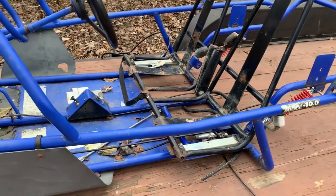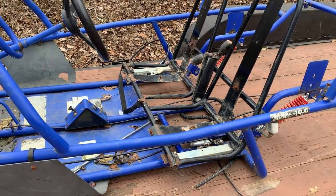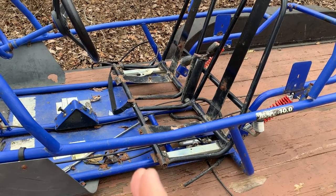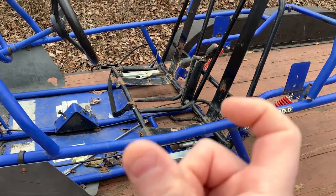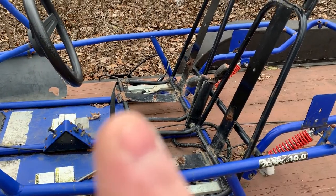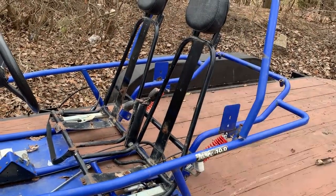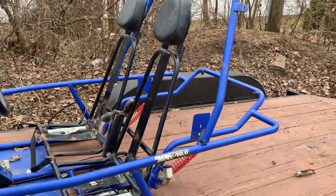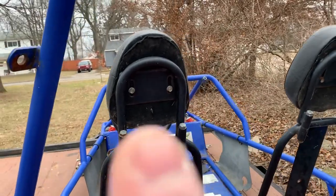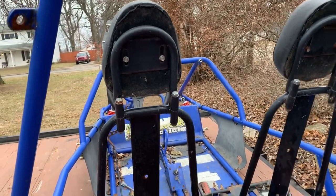The bench seat I got from the school bus is going to sit between this bar and this bar, which is 28 inches. The bench seats that I got are 38, so I'm going to have a 5-inch overlap on each side, which is fine. From that bar to that bar is 12 inches, and the bench seats are 20, so I'm going to have 8 inches out a little bit. This seat does slide back and forward — it does have a slide adjust. You can see that silver rail right there. From that bar to that bar is 25; my seats are 30, so I've got 5 inches I need to make up for, which I can do because these are already adjustable. I'll probably slot it out a little more or something — we'll see how it fits in first.